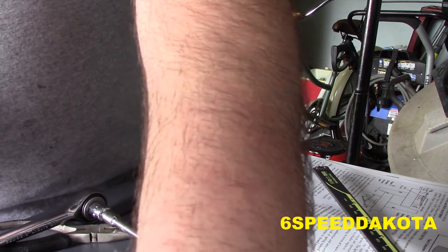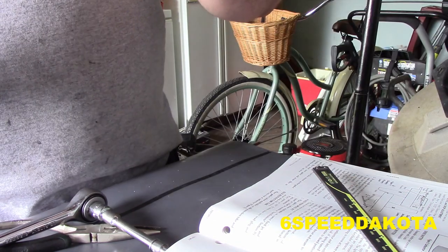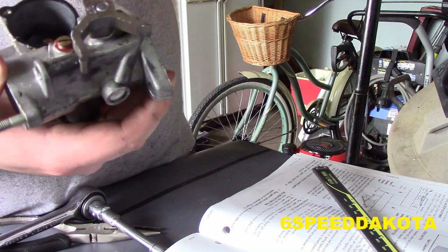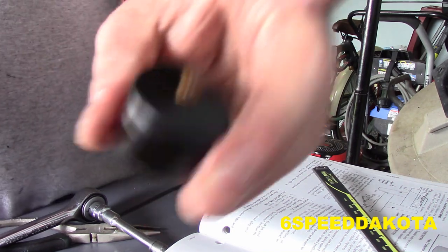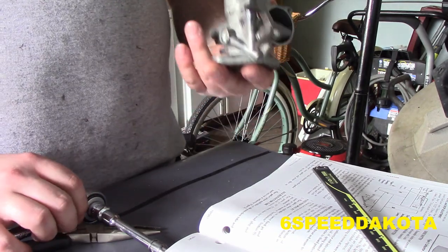Interesting. Okay, so we'll just put our needle and seat assembly, this is all of our linkages and weird stuff, aside. It looks like this guy's starting to leak almost. So here's our gasket, we can toss that out. Float sits in here. Make sure that the spring is sticking up. This one looks okay. It's just 3/32 of an inch. I'm sure it's not rocket science.